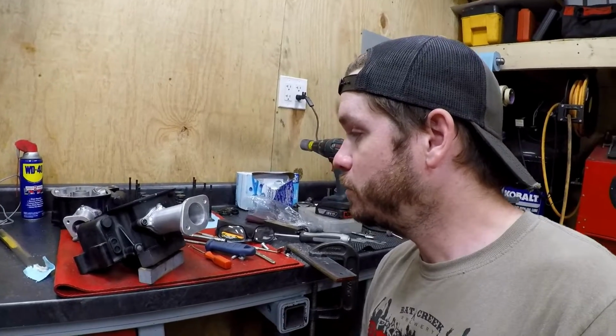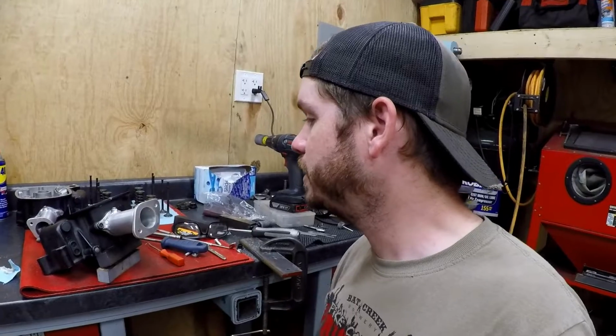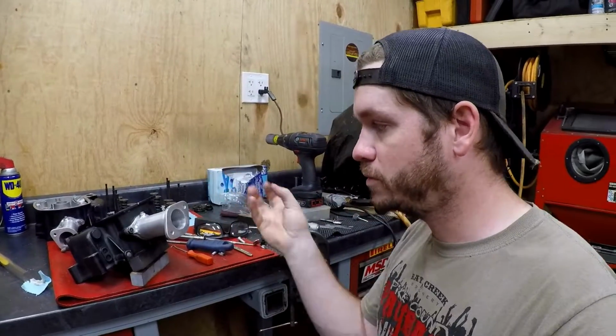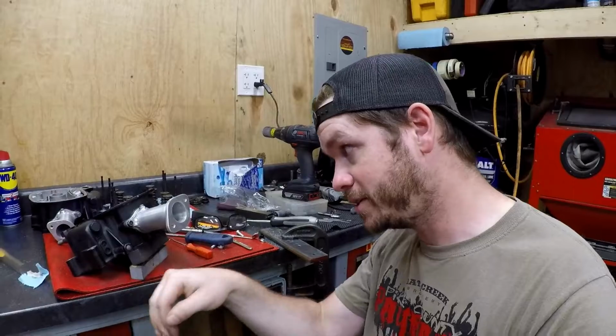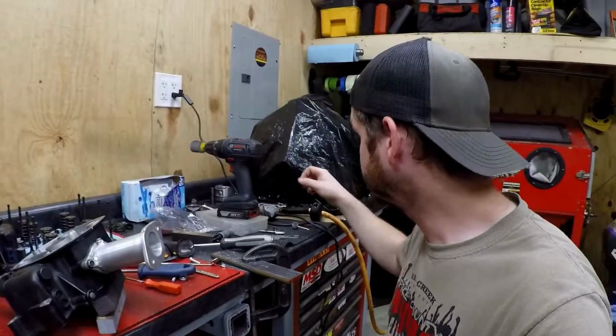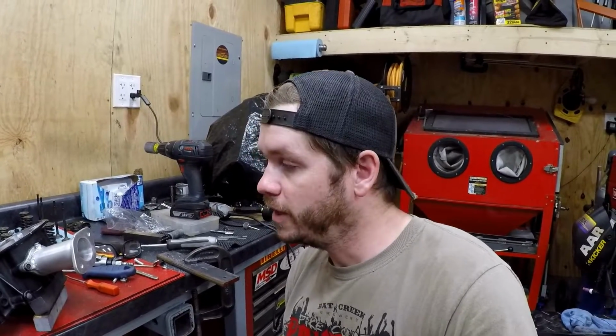And it will perform. You definitely don't want to polish it on your intake side, because you want basically a puddle of fuel kind of trapped in suspension there for the airflow to go by, and also to continue to atomize fuel as it goes into the chamber. Anyway, I'm gonna set the camera up. We're gonna continue buzzing around with the die grinder here and some rotary bits and files and picks and whatnot, and we will have some good results. So yeah.